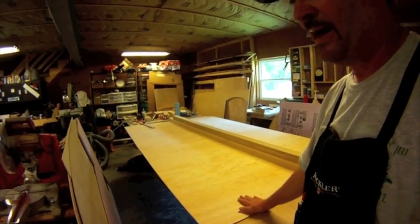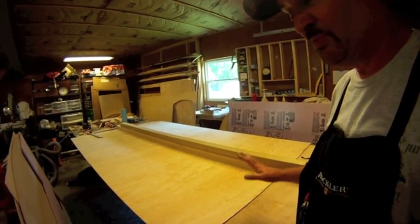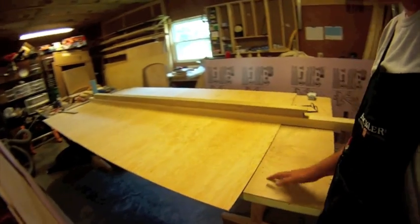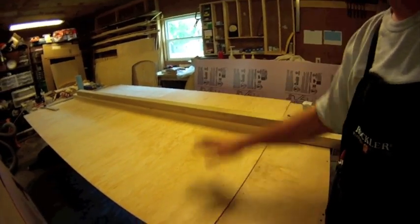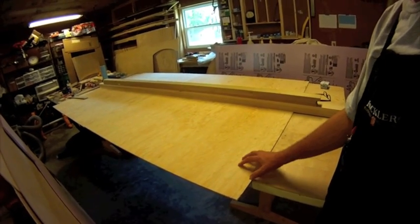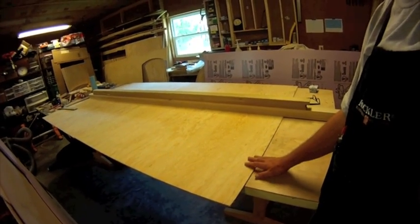So I have an inner panel and an outer panel, and then this poplar in between with insulation, just pretty much like I built the bulkheads. I'll use Kreg screws, the pocket hole screws on the corners in order to put everything together, build basically a grid out of this poplar and glue it to these panels. The bottom panel, or the road side, is 1/4-inch marine fir plywood, and then the cabin side, the part that we'll actually lay on, is 1/2-inch marine fir.